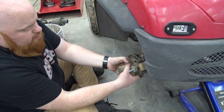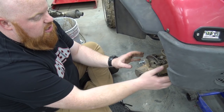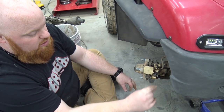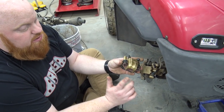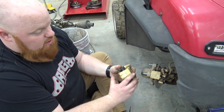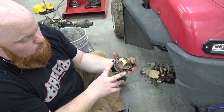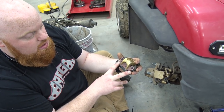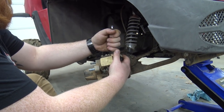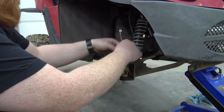I cannot turn this — the brakes are fully bled and everything, the piston just will not release. So instead of messing with this caliper, we're going to remove it and put a new one on. This is a Go Power Sports 150 caliper — this is on like 90% of 150s that have front brakes. Knowing my luck, this bolt pattern is different than this flange — it's wider and longer. No, it's the same width, just different in height. We're going to pull this caliper off with a 12mm — just two bolts, just like a car caliper.